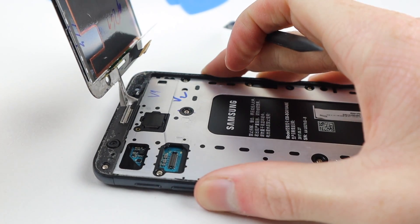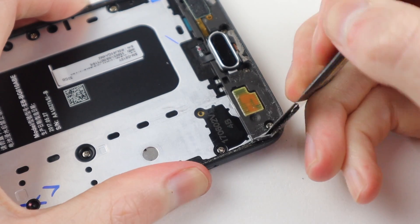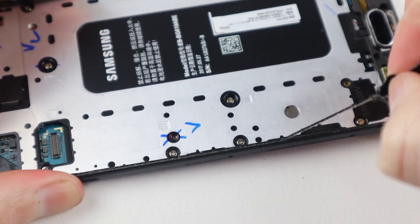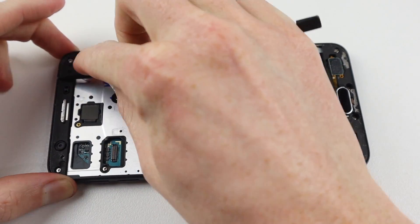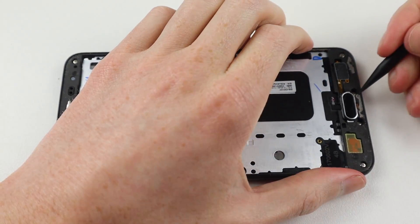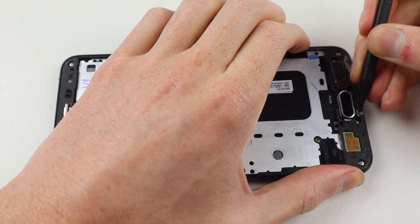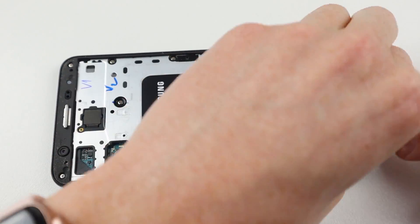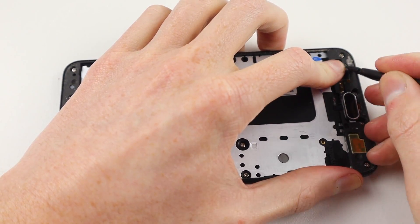You'll notice that I couldn't disconnect the battery first, which has me a little worried, but that's impossible to do when removing the display from this phone. Once I have the screen assembly removed from the device, I can use a plastic spudger to remove any adhesive or glass left on the frame so that when I apply the new adhesive and stick down the display, everything will sit flush and adhere correctly.